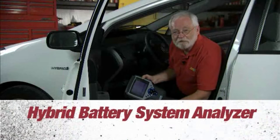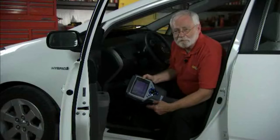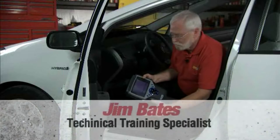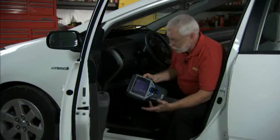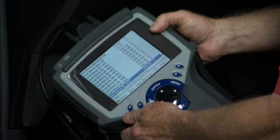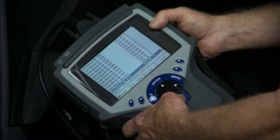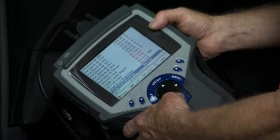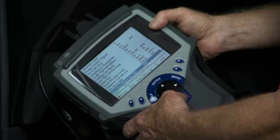When you're trying to diagnose state of health issues on a hybrid high voltage battery, typically we use a scan tool. Go in there with the year model and request to talk to the battery's ECU, ask for data stream, then we can see stuff like the min-max battery voltage and all the block voltages. On a second generation Prius, there's 14 blocks to look at. Then we want to look at state of charge and the delta temperature across the battery pack to figure out state of health.